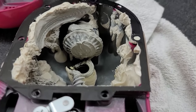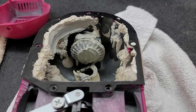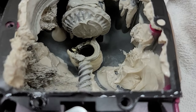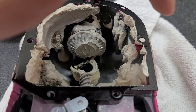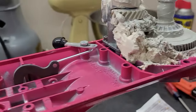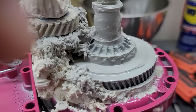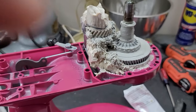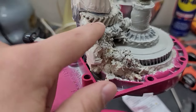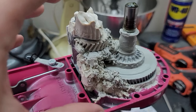Let's take a look at what we've got inside here. As stated previously, in 2016 they switched to a white grease to kind of cover up the fact that they leak. Here we have the hub gear, the drive gear that connects to the motor, the transmission, the center gear, and the worm gear. Some of yours may look a lot dirtier than this — it'll be black and hard. This one is still pretty fresh. Some may be more like rubber on the outside, packed up heavily in the back of the gearbox.